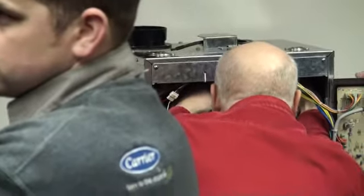A little thing about these water valves. This is your water pressure switch. All the new ones you get now are no longer white - they're black, and they have a stainless steel thread instead of a white thread. We made that change because last year out of 13,000 machines we had 146 failures of that valve. The manufacturer on some of them drilled the hole inside too big and thinned the sidewalls of the plastic. It gets really hot on top of there, makes it weak, it fails and blows street pressure right inside the whole box. If that happens, we replace the machine. If you have any in the field with the white pressure switch and want to replace it with a black one, let me know. We even have a program - fill out paperwork, send it back to us, we'll send you 75 bucks to change that out.